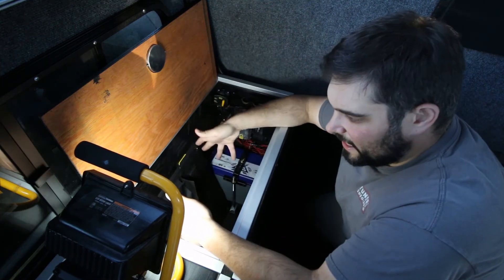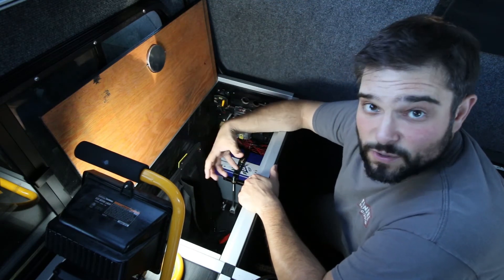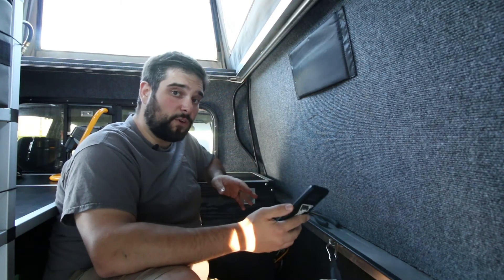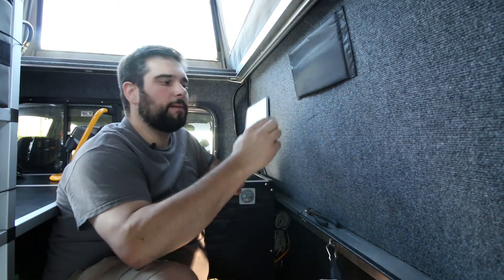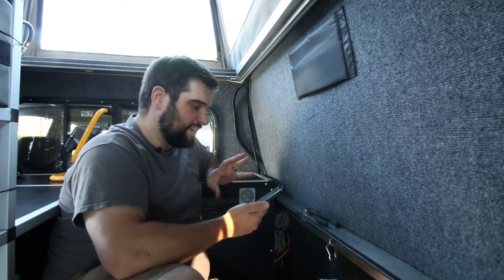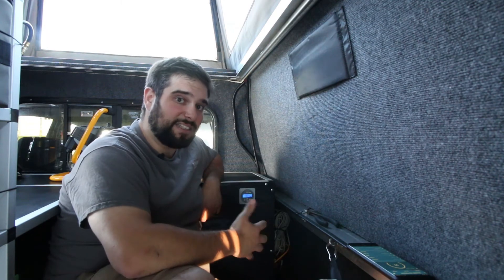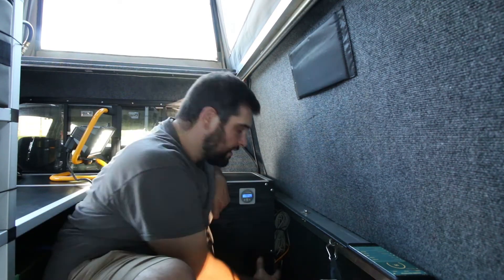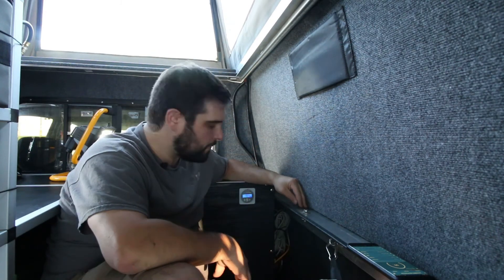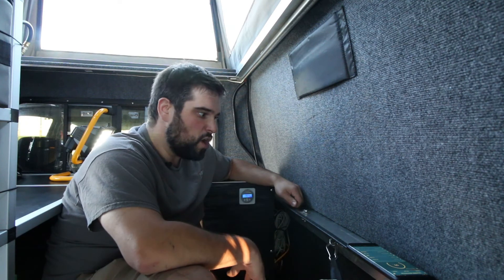I have a pretty big open area on this side of the cabinet housing my foldable solar panel as well as different electrical components for accessories from around the truck. The Victron battery monitoring system is fully Bluetooth capable, comes with a supporting app that gives you a complete readout on the life and history of your battery. It also comes with this head unit here that allows you to go through all the different settings to set up your battery and has an at-a-glance readout to make sure your battery is healthy and performing properly. The box on the side is where all the electrical is run in the back — I'm probably going to get a little Velcro panel to cover that up, but I want to leave it accessible for adding wiring or diagnosing issues.